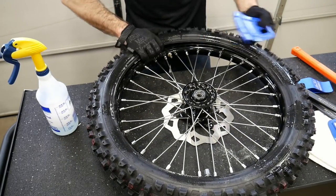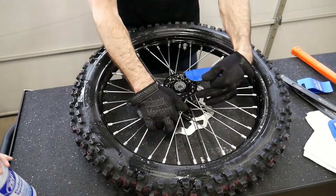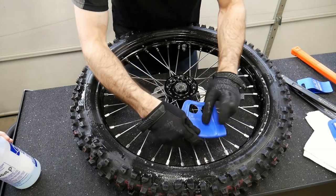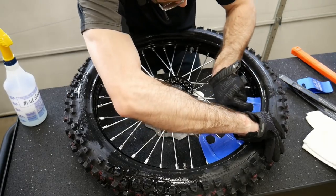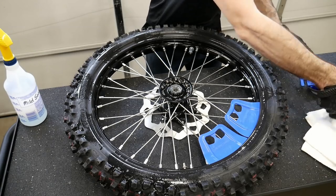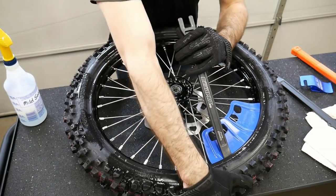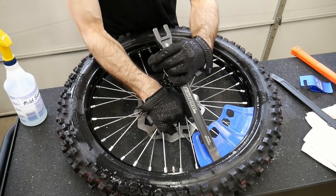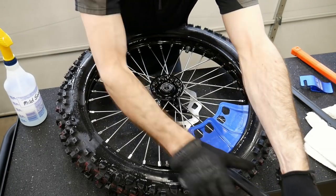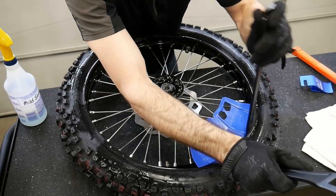And actually what you should do is operate it away from you so that you can hold the tire on the opposing side with your stomach. You're applying pressure. And this is where we get to use the bead buddies. And we're going to take our first tire iron. This first part should be easy, but what I should mention is you tuck the tire up against your stomach and you pull so that you're creating space and over the top. And then you want to take a second one and we're going to just back it off a little bit.